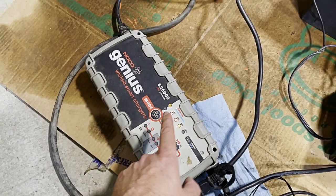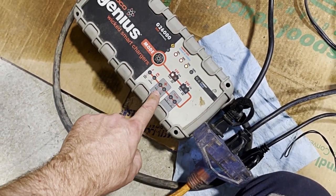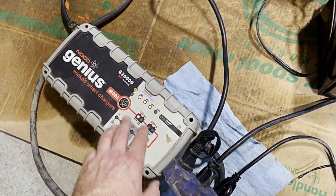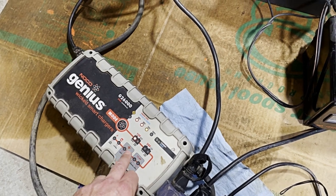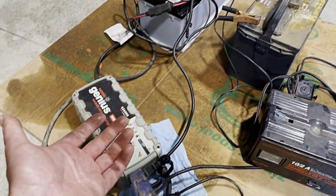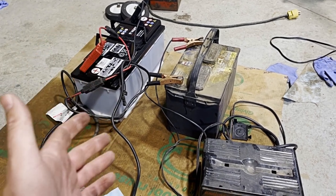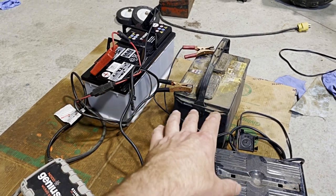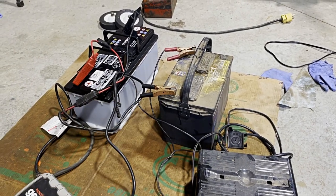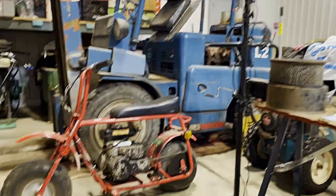Meanwhile the European SUV battery is getting VIP treatment on the smart charger - started at 50% and now it's flashing 75%. Another option on these batteries is the rescue or recovery mode - like a desulfation charge. I do these sometimes on old batteries and it does an okay job. If you're doing it for yourself and just getting by, fine. But if these are client machines, rental machines, or machines you're counting on, you're better off just making sure you have a good battery. These pulled-from-service batteries will most probably get recycled - I don't need a big pile of dead batteries around.